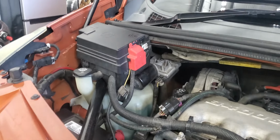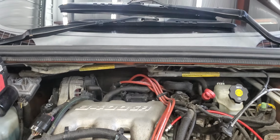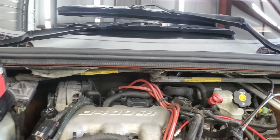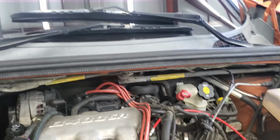There's no way engine vacuum can pull the water meth in while you're just cruising, let's say. The system doesn't run at idle, doesn't run when you're cruising. It's there for when you get into the throttle. And at that point, it does multiple things.